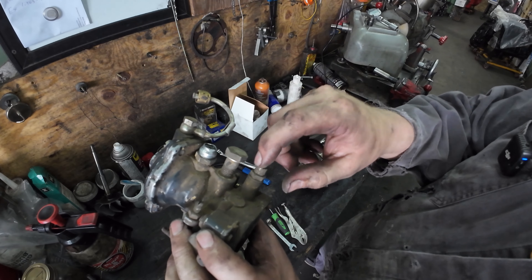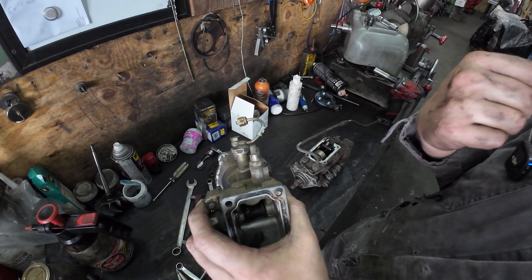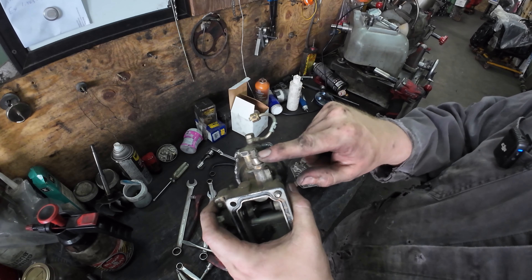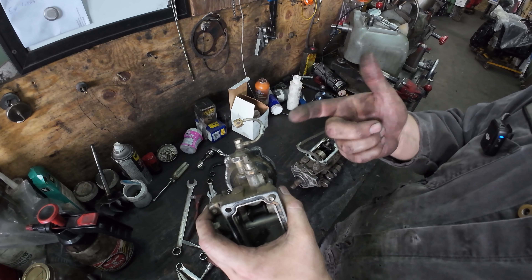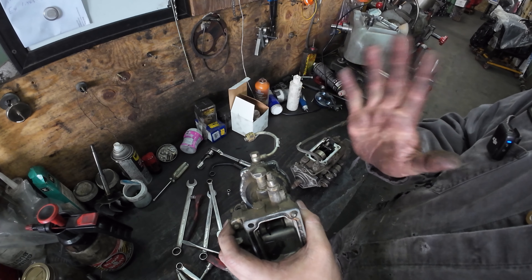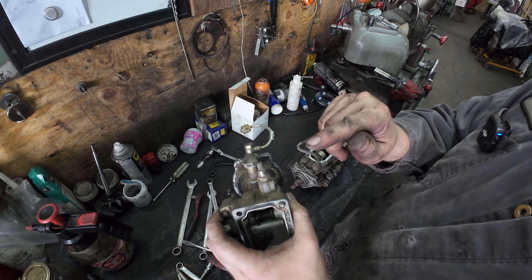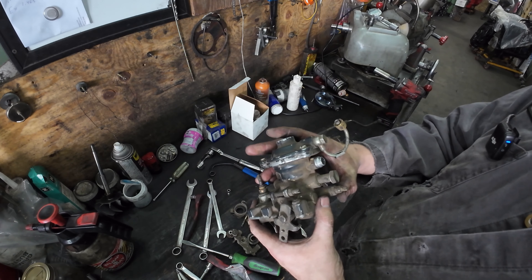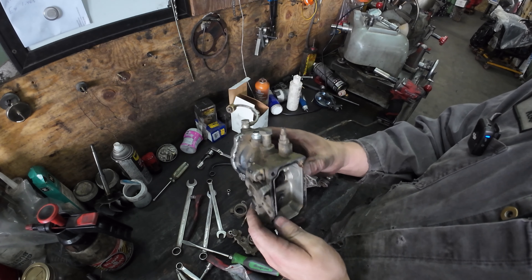For the fuel screw, I actually take it right out and knock the stupid little safety collar off. You can see how much more this one is screwed in compared to where it started. I wind it in until you gain about 250-300 RPM from where you are. If it's never been touched, I really should recommend you have the intake pipe off and a plate there just in case it runs away - better safe than sorry. Going up 250-300 RPM is pretty safe to do.